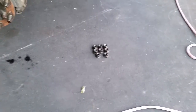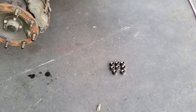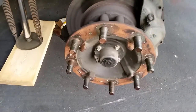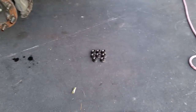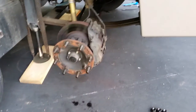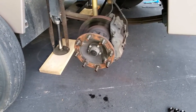That big impact really makes quick work of those large nuts. Always keep in mind when these go back together, they torque up — I believe it's about 495 pounds, and right on the nut it's stamped 450 to 500 foot-pounds. That's a lot of torque. When I put these back on I'll tighten them with the impact, but I'll drive to a tire store, borrow their five-foot torque wrench, and check each one to the correct spec.